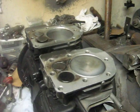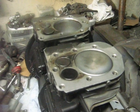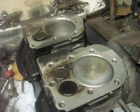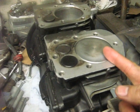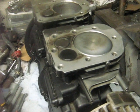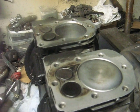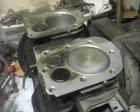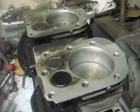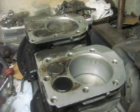I'm going to make this engine what I call odd fire, so the two pistons don't come up at the same time. Number one cylinder here is at the point of firing — both valves are closed. Number two is just closing the intake valve. So number one is going down on the power stroke and two is coming up on compression.